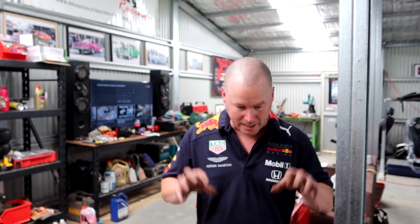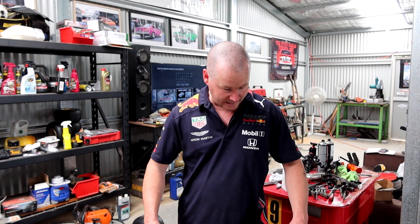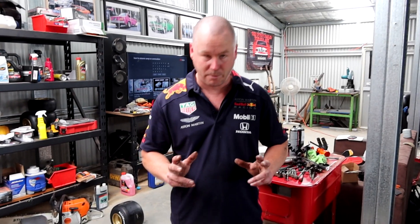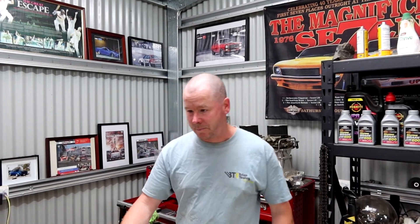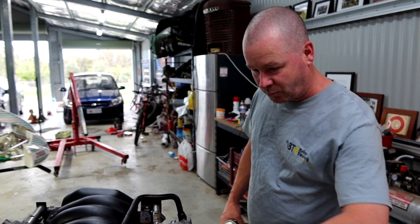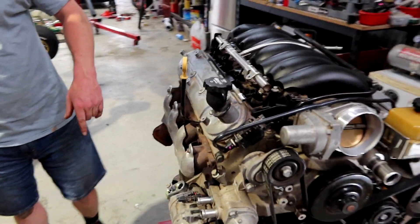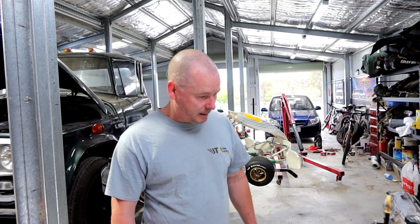We'll leave all this intact for the moment and keep going on our teardown. Hopefully these videos are helpful on how to pull it apart — we're about a third of the way. We're not going to strip the entire motor down because we're going to do it bit by bit. We did want to check out what condition we're in, so that's good — no huge surprises there. Our next step is to make sure everything else is in check on the bottom end, put the sump back on, and we're going to ship our heads away. We've cleaned up the LS — looking a bit more bare and naked now. All the wiring loom's done, coil packs are done, sump is off, dropped the oil — might be enough for part two.